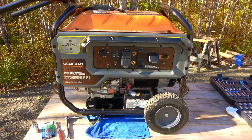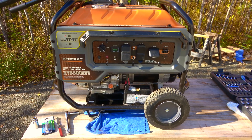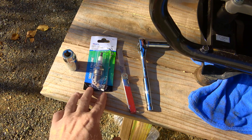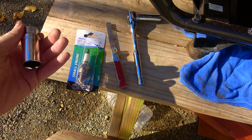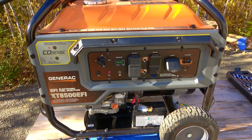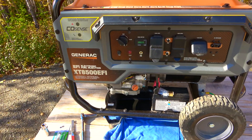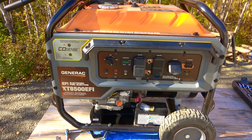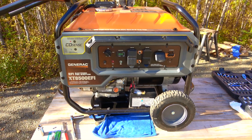In this video I'm going to change the oil, clean the crankcase oil filter, check the spark arrestor and clean if necessary, check the air filter and clean if necessary, and change the plug. I have a Torch small engine plug here — it's an F7RTC, which is what came from the factory. That takes a 13/16 spark plug socket. I was able to find the proper gap in the manual: .028 to .031. I've already pre-gapped it so I can get .028 in but not .031, so it's pretty good.